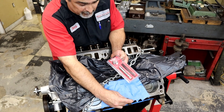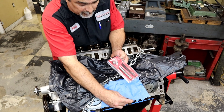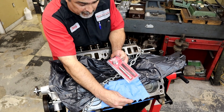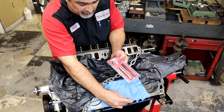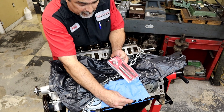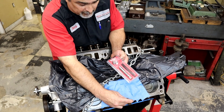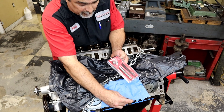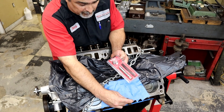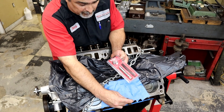Watch your eyes and ears. I've already blown the hole out. Now we're going to get into the install tool — it looks like a bolt and it has a little finger at the end to catch the helicoil. Here's the helicoil — it's going to go in real loose until it catches that little spot. It's actually quite loose, and that's okay, because it's going to compress as you're putting it in. You can practically do it with your eyes closed.